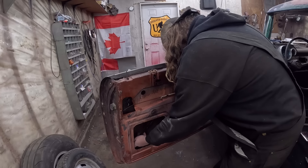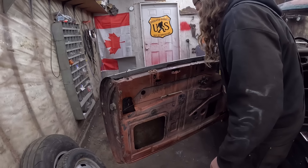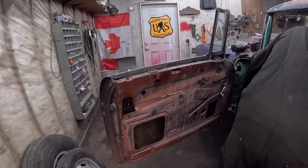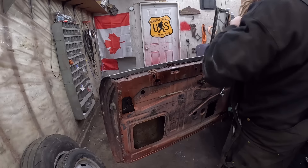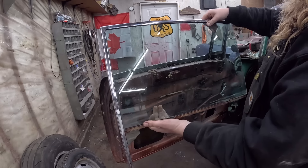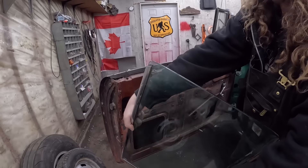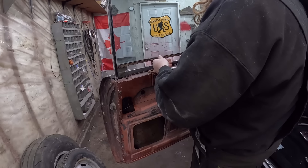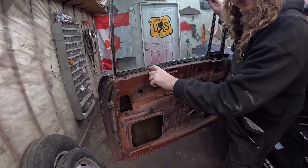This does have a stop on the bottom — it's already on there — and it has those stops on the top. Now I can roll this up. Now look at the piece of glass. Hard top glass — it's kind of got a shape to it, and there's a left and a right. This section here is what's going to fit in that black piece, and then the regular glass edge will fit in there. This one looks a little sacked out but I should be able to figure it out. Right in there — see how it has these bends in it? That's what the stoppers hit. They're the only thing you've got to kind of get past.